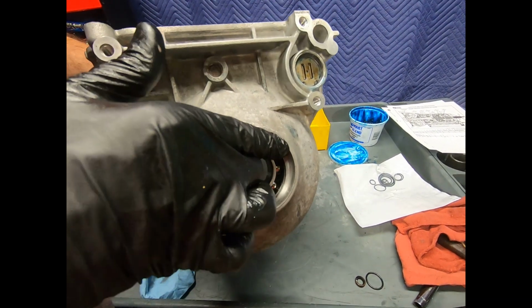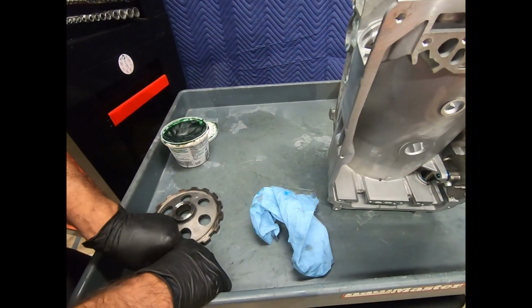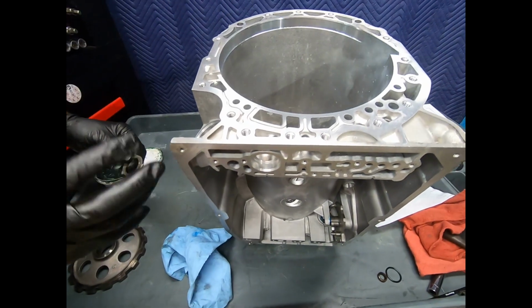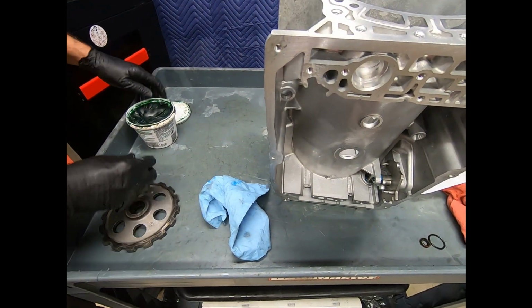There's the snap ring. Now, we're getting ready to put in the parking gear, and here are the 2 shims that we stressed so much before. And I'm going to actually have to put this down and put the B3, B2 clutch assembly there on top of it. And I need to make sure that these are solidly retained.